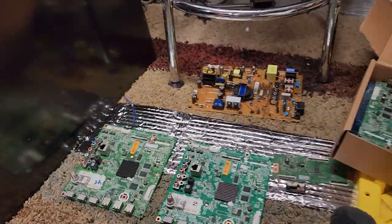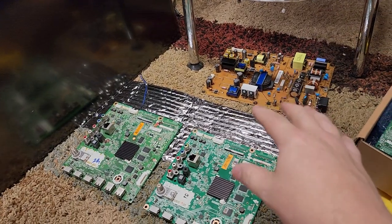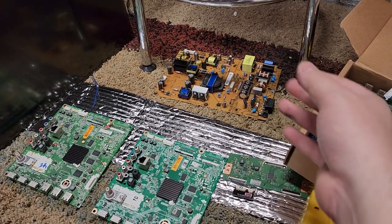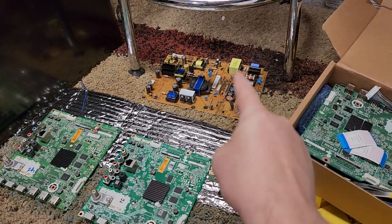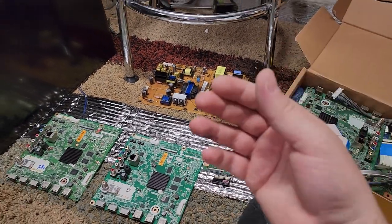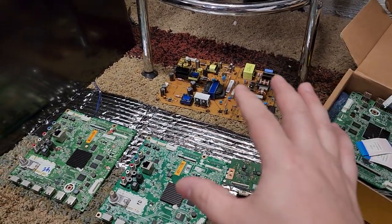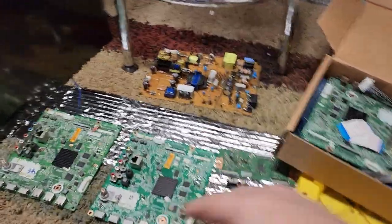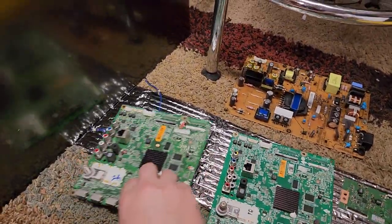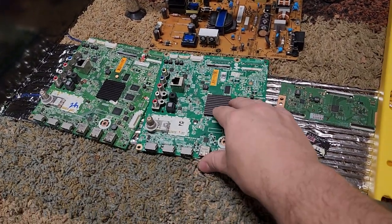So I have all my parts. The TV symptom technically did change. I changed out the power supply, but I knew it wasn't really going to solve the problem. What I had was standby power disappearing — when standby power disappears, the whole machine shuts down. What it really was: as soon as the set notices a fault with the LED system, it shuts down with no notice whatsoever, even though on the screen it looked absolutely beautiful.